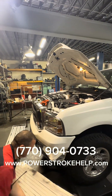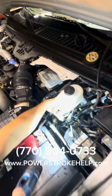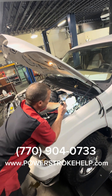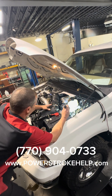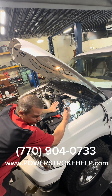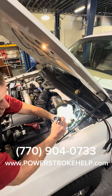One of the biggest mistakes people don't know about: up here on the master cylinder, the one that came on this truck only had a single port for the cruise control redundant pressure switch. What has to be added is a brake transducer — another pressure sensor that is linked to the TBC. That basically tells the TBC how much brake pedal pressure you're applying, so it can apply that gain to the trailer brakes.